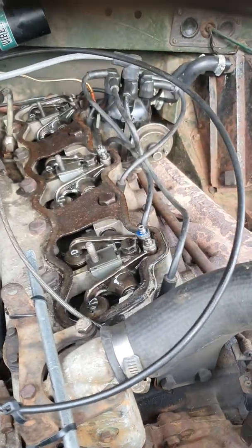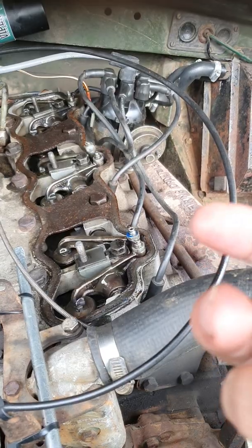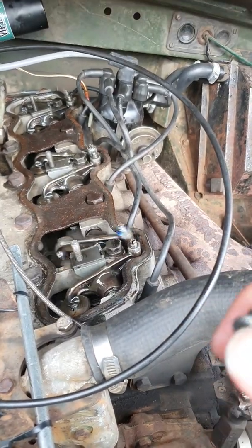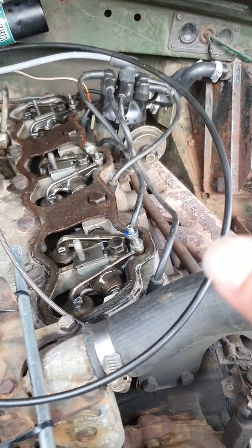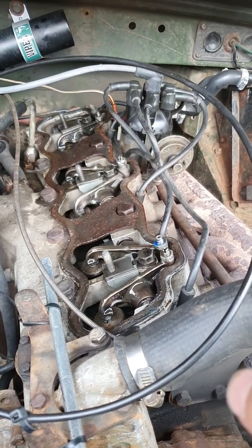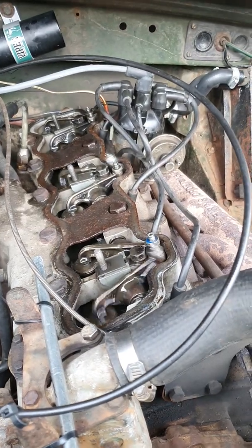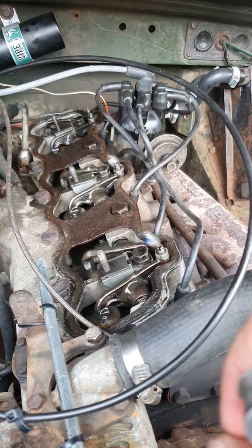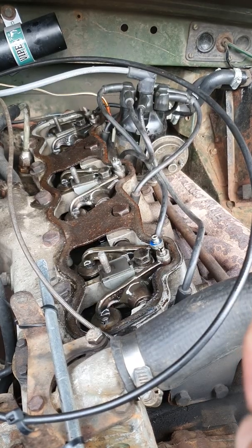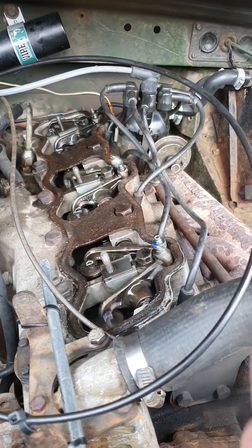I'm finished with the inlets now. As I've warmed this engine up more and more it gets noisier and clattery — there's nothing you can do about it, it's just the way it is. It's quiet enough. You need to allow for a gap; you can't have it on the tappet all the time because then you'll lose compression and risk burning the valve seats and other things.